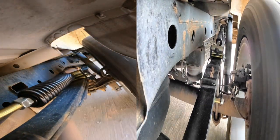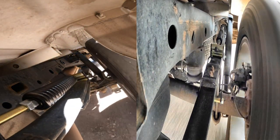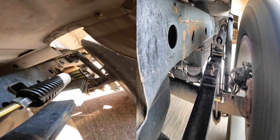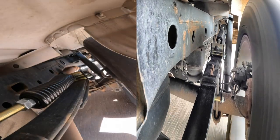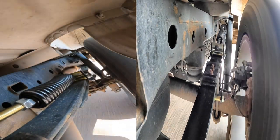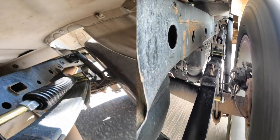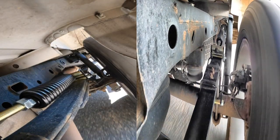I have it set at 25% — the white disc — which is 1 millimeter. That's the gap between the coils and the spring. I figured that's probably a good way to do it. If I need more, I'll do the 2 millimeter, which is 40% increased capacity. I may go up there if I go back to haul 12,000-pound trailers. This truck is rated to tow 12,800 pounds — beefy trucks with a hell of a frame.